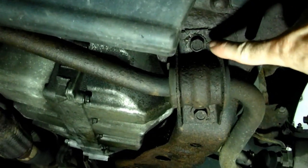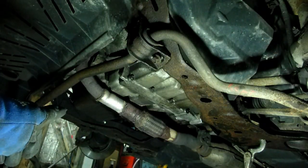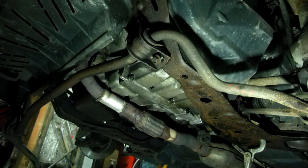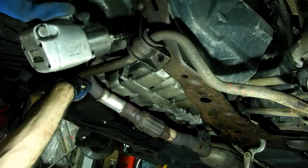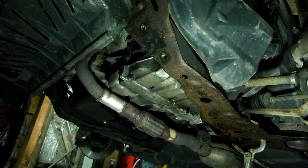Be careful of these bolts — they can strip out of the subframe. If that's the case, you'll have to try to get a wrench in there to hold that. I just removed the clamp on the side where I took the control arm off, so the bar is hanging down and all we have left is the clamp on this side. This would be a lot easier with two people, but we will persevere. And there's our stabilizer bar — she's all out.